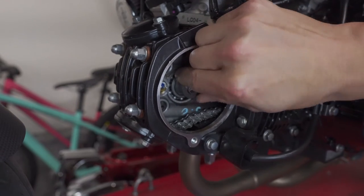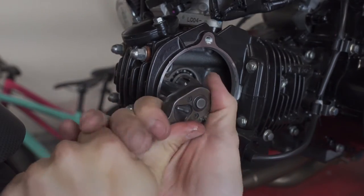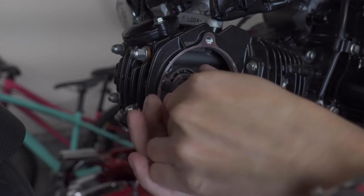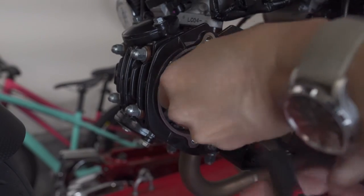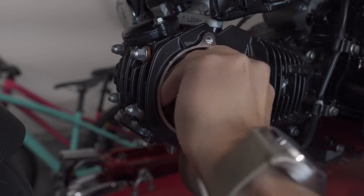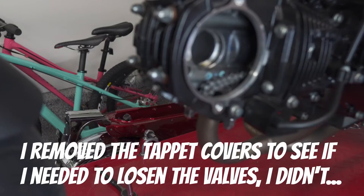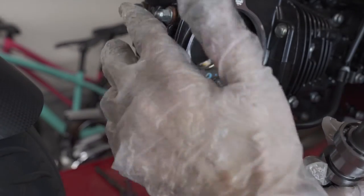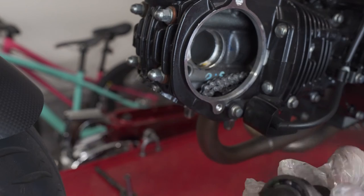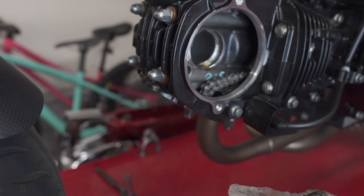This is the cam that we're replacing. Looks like it's also retained by a 10 millimeter bolt right there. I realize I had the wrong part in focus, but it looks like I didn't need to mess with the tappet covers to take it out. I didn't make any adjustments to either of the valves, but it just took some wiggling and it did come out. I'll go ahead and leave the covers off for now in case I do need to loosen them to get it back in, but as far as removing it, I didn't need to pull them off.